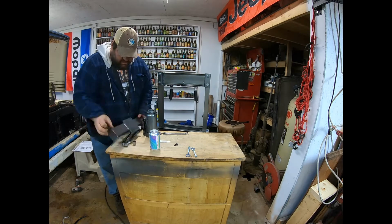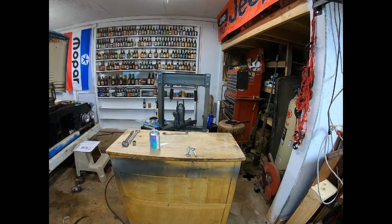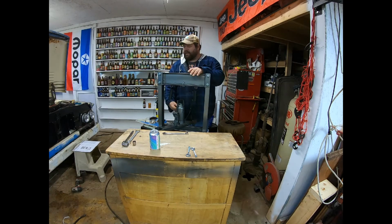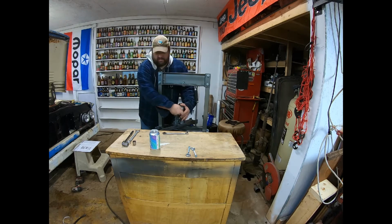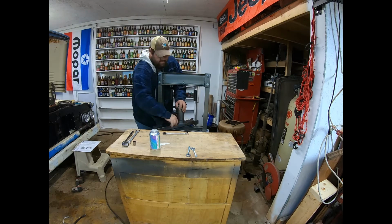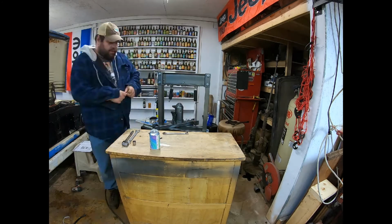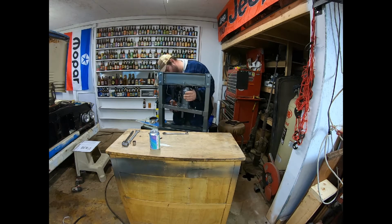Part of the trick is right here. Now, whenever we put this jack on, there is a specific direction that jack goes in. Right now, it's backwards. Now, I put it on, got the springs on it, it was kicked to the side. I turned it around, it was kicked to the other side. So what you have to do is make sure that the jack is bolted to the cross member in the right bolts. It is not centered.